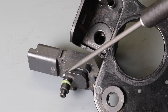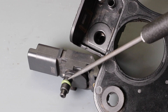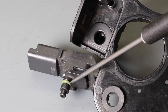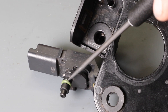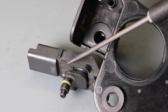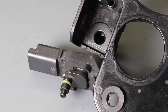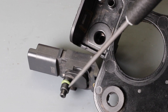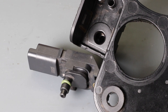If you suspect a leak between the tray and the pressure sensor where the O-ring is, carefully inspect the O-ring and make sure it's not damaged. Some people have tried using different dimension O-rings, but I measured both the diameter of the pressure sensor and the bore, and I think the O-ring is sized correctly — you don't need a larger one. What you could try is applying some silicone grease to the O-ring, which would certainly help create a better seal and reduce the chance of damage during installation or removal. Just make sure none gets into the pressure sensor opening.